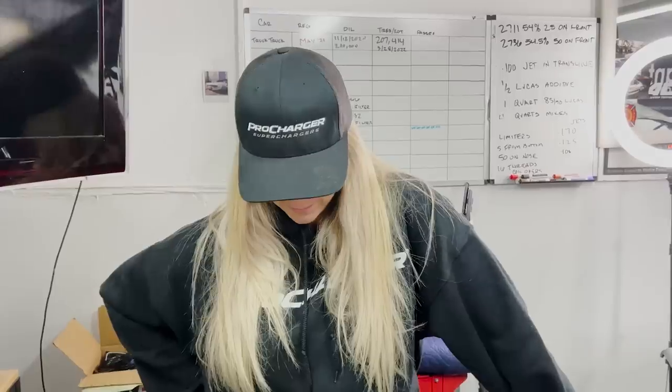Today, we are making up for my inability to drive a stick shift. I may have taken a little bit of material off of my clutch because I didn't know how to do a burnout, apparently. I didn't understand that bring it up and dump the clutch meant bring it up to 6,000 and dump the clutch. I was at 3,000, so I screwed it up. So my pedal engages up here when I want it to engage down here. I have a very nifty McLeod hydraulic throwout bearing, and I can disconnect the line and spin it by sticking my hand through a little hole in the side of the trans. I can spin it and give myself more clamp load.